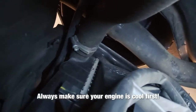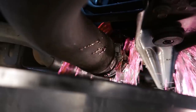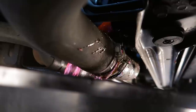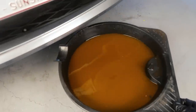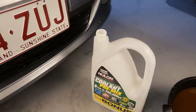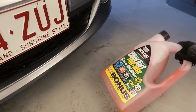To drain the coolant in a BA XR6 Turbo, you have to remove the lower radiator hose. Some cars might have a bung in the bottom of the radiator which you can simply unscrew to drain the liquid, but there's no such luck here. So I'm simply going to loosen the hose clamp and then start to pull the hose off the connector, making sure that I've got the drainage pan located directly underneath. Now that the cooling system is fully drained, we can get a look at the coolant. On first inspection it actually looks extremely dirty, but I think it's partly because it's sitting in this black drain pan. After I tipped it into an old coolant container, it actually looks like a pretty decent colour — very close to the replacement coolant.